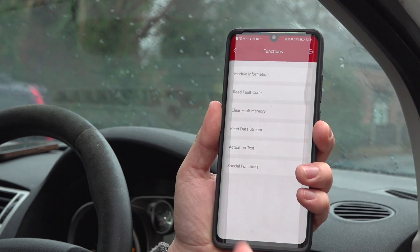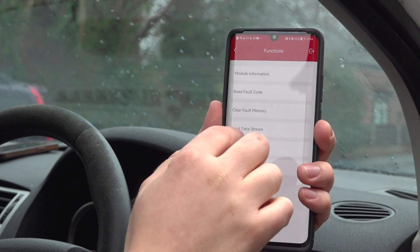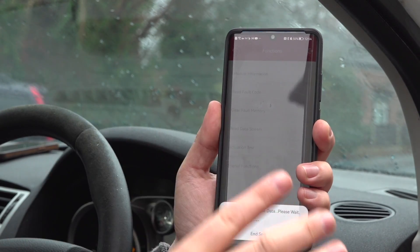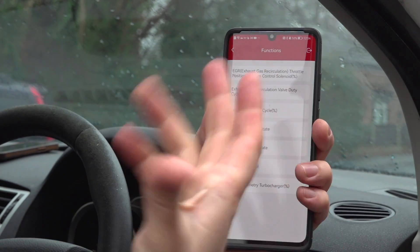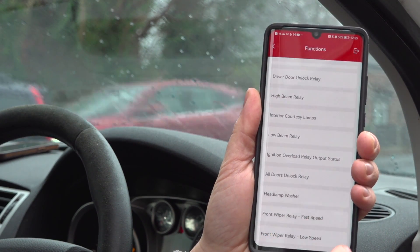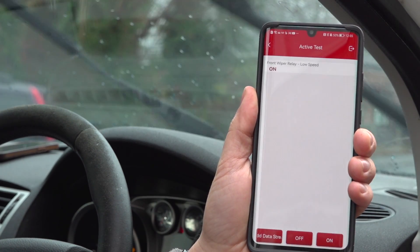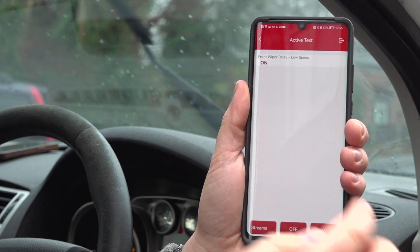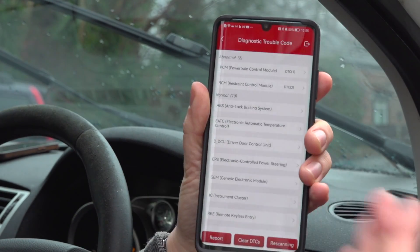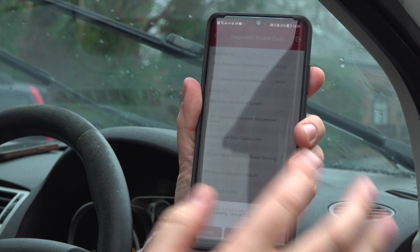What's really cool about these diagnostics is that I can not only do the fault codes, but I can also perform actuation tests, which means there are certain parts of the car that I can turn on and off just using the phone — which is really good for fully trying to diagnose where faults are. So if I click, for example, the front wiper relay, I can actually activate this relay and the wipers should come on. See? How cool is that? And until I turn it off, it'll just carry on. You've got this kind of control for all the modules throughout the car.